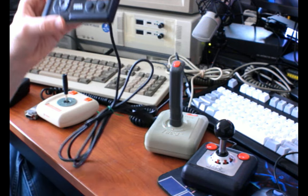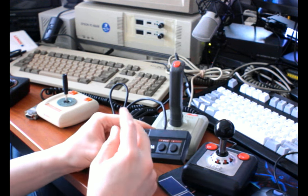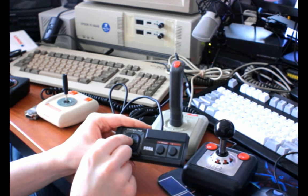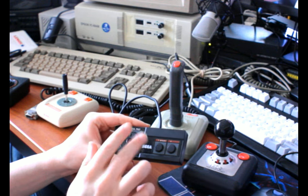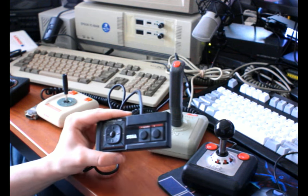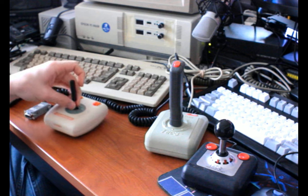That stuff is, you can put a couple of small clippings of it, just stacked on top of each other in the center on the underside of the D-pad, and it'll rock back and forth on that, and that somewhat fixed the problem for me. It just took a few tries to get it just right, which was pretty annoying.